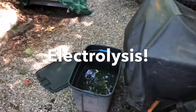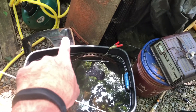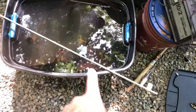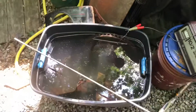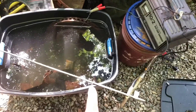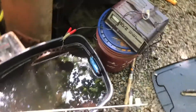I'm doing electrolysis — the covers are basically tins and shielding for the Kohler Magnum, so I've got the two side ones and the protector or deflector for the fan. It's the piece that when it spins around knocks stuff away. I have a rotor as my sacrificial metal — scraped it down. These are all on wires attached to metal. I'm pretty sure you put black on your pieces and the sacrificial gets the red.